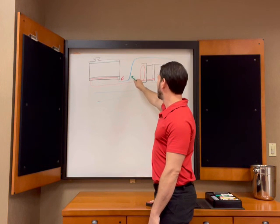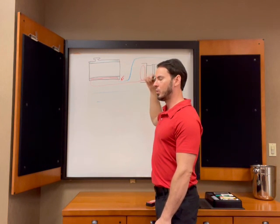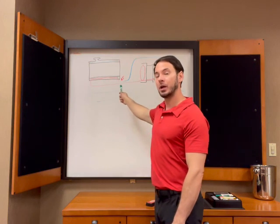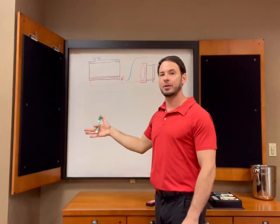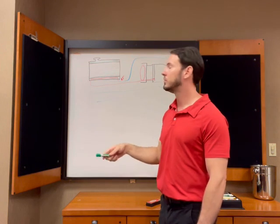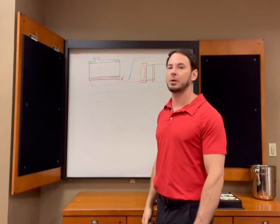But anyway, that car, in the winter, if the outside temperature was below about 40, even if it heated up enough to give me torque converter lock, if I went down the freeway for more than a couple miles, it'd actually cool my fluid off so much that it unlocked the torque converter, heat it back up, lock my torque converter again. We don't want to be doing that.